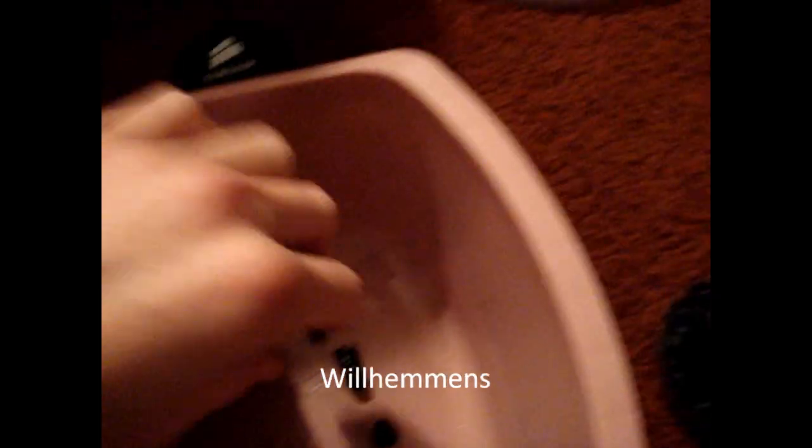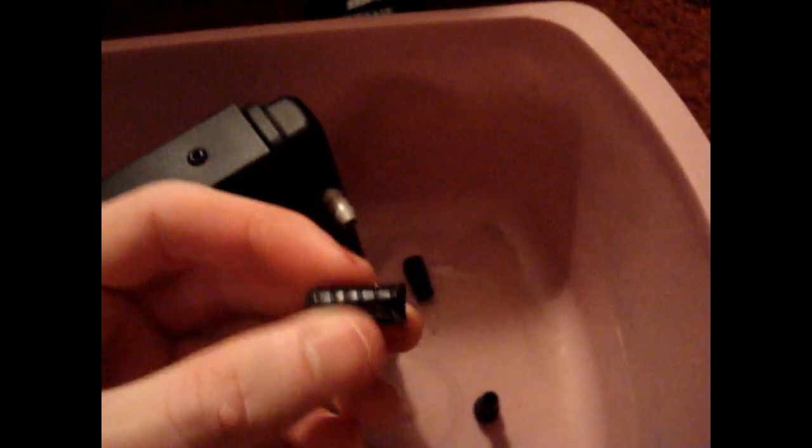What we have here is I just finished taking the tubes off from the pump and the radiator. Basically what's on the forums on Overclock — I forget who said it — but you have the plastic tubing that goes over the barbs here. What you do is you cut just above where this thin piece where Corsair compressed this tubing.